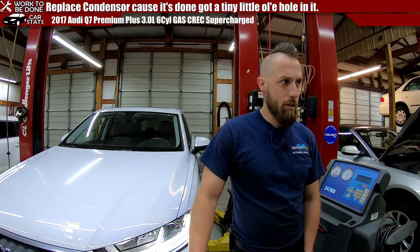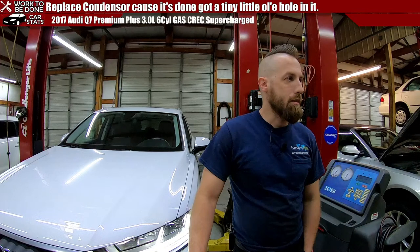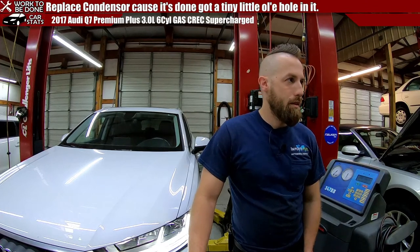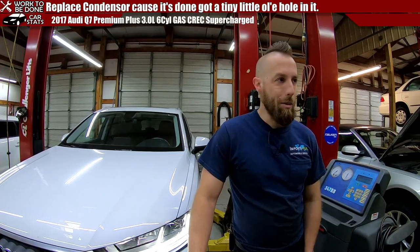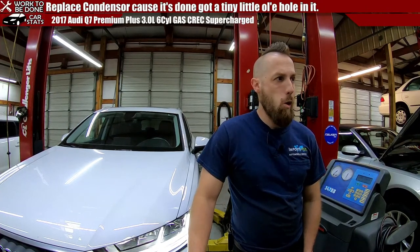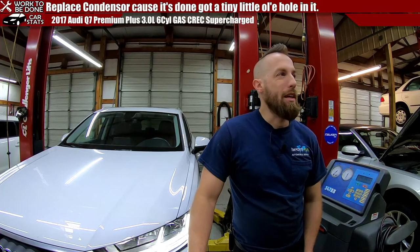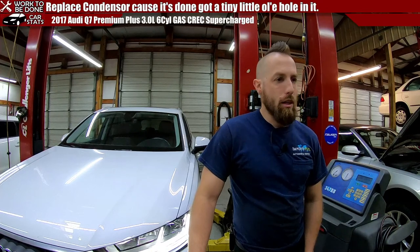Airbags. Let's make sure it's nothing super mad. Both intermittent. Excellent. There's that. Check the engine. Yeah, we had an active radiator shutter code. Intermittent stuck open. It's not. It was unplugged. I guess we'll check the auto HVAC. Might have a code for low pressure. High pressure sensor, amplitude too low, intermittent. Central electric.